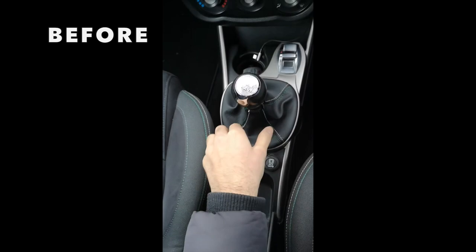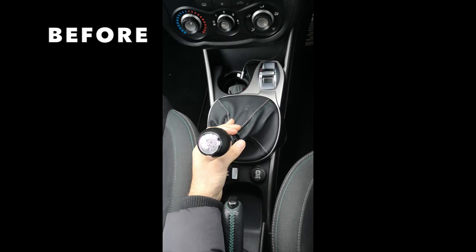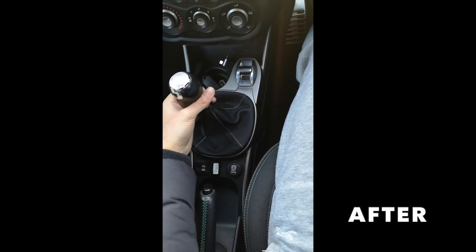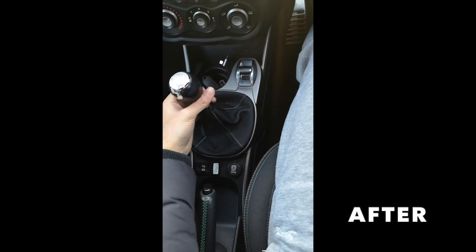Now the shifter is all installed. Quickly go inside the car and make sure that the shifter works as expected — it should glide smoothly into the gears. Once you're happy, just rebolt on the battery tray, strap up the battery, and that's it — job done. Go and enjoy your incredible short shifter.